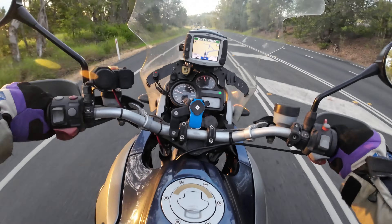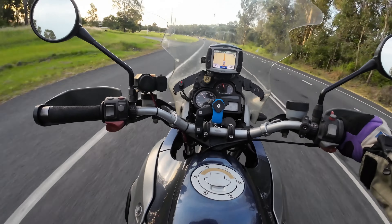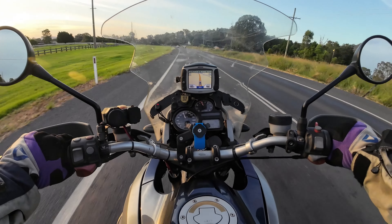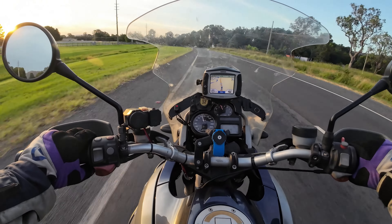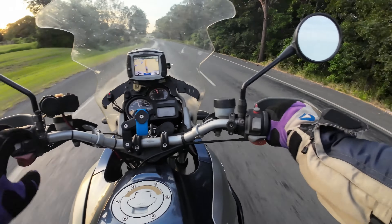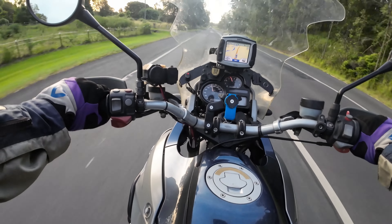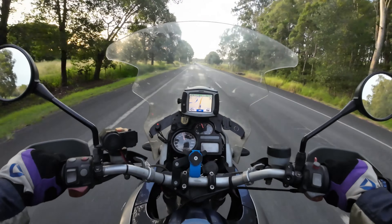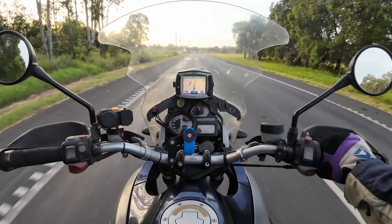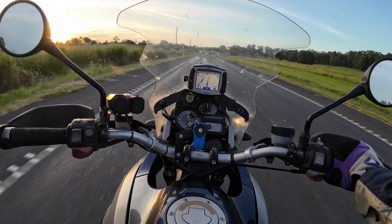Hard acceleration - look at that, she's just cutting out straight away. It's almost like it's running on one cylinder. She's up to 100. So at really low throttle inputs the bike seems to run fine, but as soon as you open it up it cuts out, almost like traction control on the new bikes. This obviously doesn't have traction control because it's an 05 model. I was sort of hoping that loose terminal might have been the cause - maybe it's just not getting enough voltage through to the regulator.